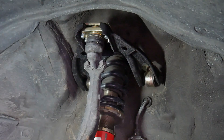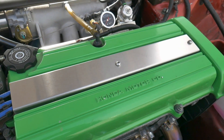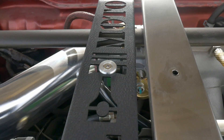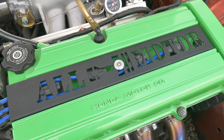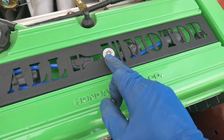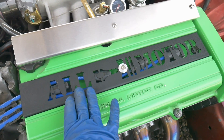Now let's get that spark plug wire cover installed on my B20. Currently I have the eBay one, which I picked up for about $30 shipped — stainless steel, mounts in two positions, really nice on these B20 valve covers. The EFparts one is a lot thicker, so it's more heavy-duty. It only has one mounting point compared to two, but it fits exactly the same. It's very easy to install — you remove the nut, put in the extension that screws onto that spot, then the supplied Allen head bolt slides in and holds it in place. On Mo's website he has solid wrinkle black ones as well; I don't see them up for sale yet but they'll be available shortly.